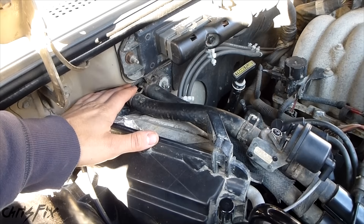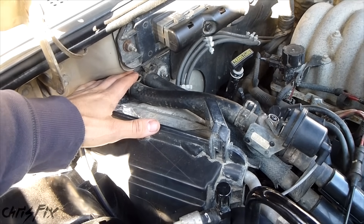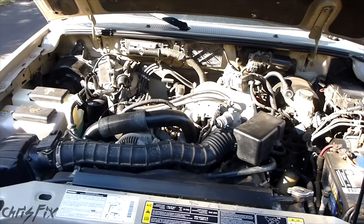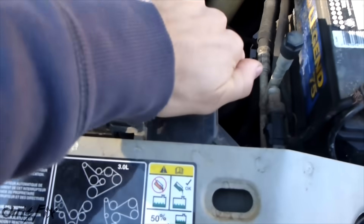So if you don't have enough coolant, your engine might be able to run at the correct operating temperature. But because the heater core is so high up in the vehicle, there might not be enough fluid to get in there and give you heat inside your car. So the first step we're going to do, since the engine's still cold, is go check the radiator and see if there's enough fluid.